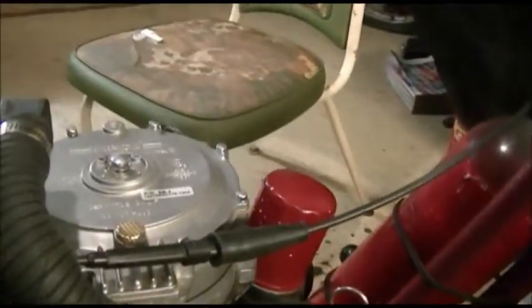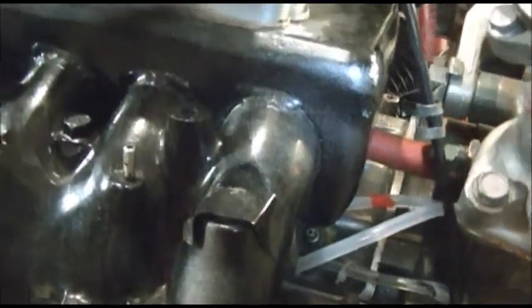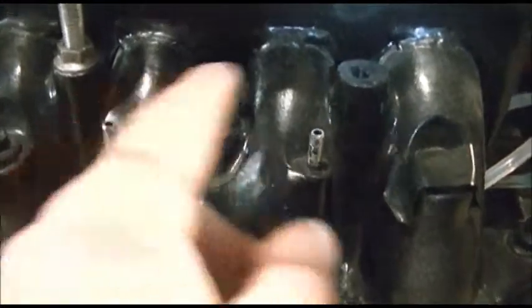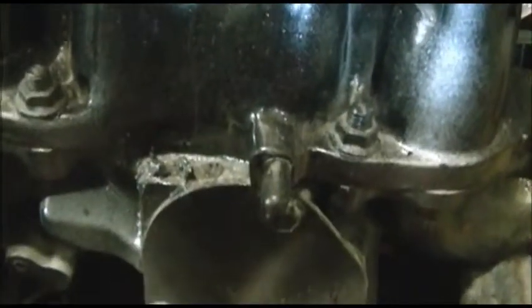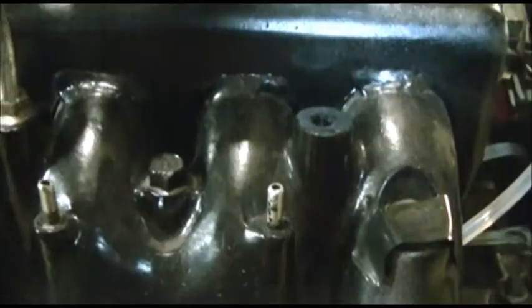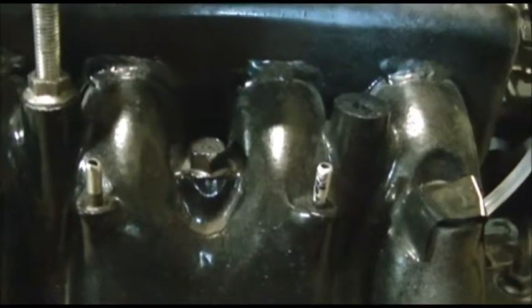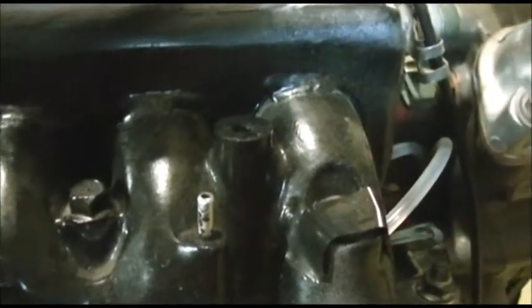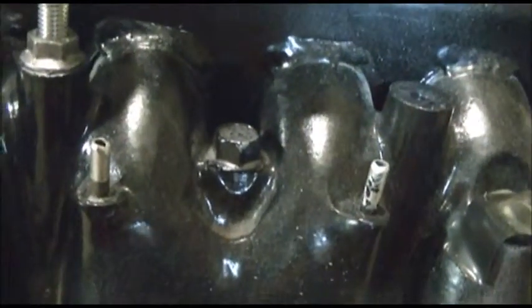That's probably about all the new ideas I've put into it so far. I was feeling kind of shitty there for a while and didn't do a whole lot on it, but surviving. Oh, there's something about a bump start I was thinking about. These are the two ports here that I ran my vacuum gauges off of — maybe we could run our vapor into them. It would be much closer to the rotors from there. They're both feeding into the center iron, so we wouldn't have to have that port up in the carb. It would be feeding in below the plate. I think that stuff has a tendency to drop, so it should drop itself right in there. Just tell me what you think, and if you don't like the idea, that's cool.